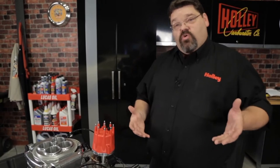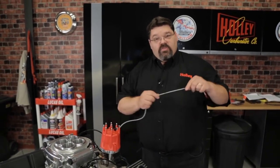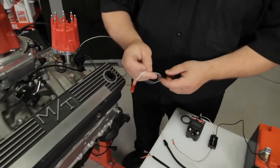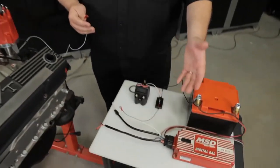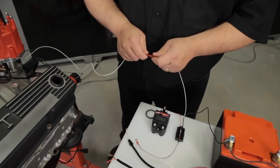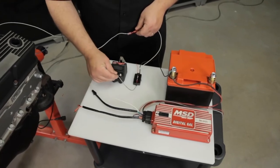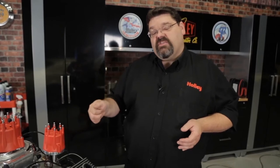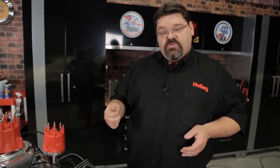From that point, you're going to need to have the ECU send an output trigger to whatever is going to control your coil. Look at the input-output harness for the solid white wire labeled 'points output.' Take that white points output trigger wire and connect it to the ignition driver that's going to drive your coil. If hooking up to the Sniper coil driver, find the white wire coming out of the coil driver and connect it. From there, take the gray wire and connect it to the negative side of the coil. The positive side of the coil will go to a switched 12 volt source tied to the ignition run side of the ignition switch — that side will have power during key-on as well as crank. If you accidentally wire it to the accessory side, it will shut off during crank and the engine will not start.